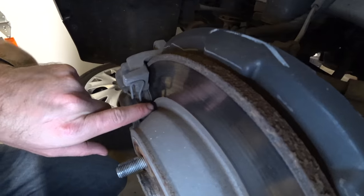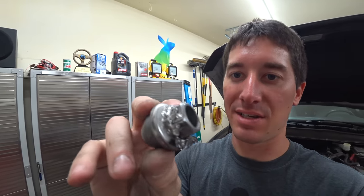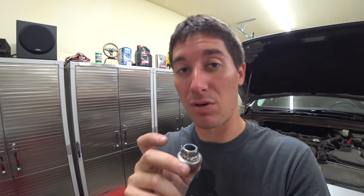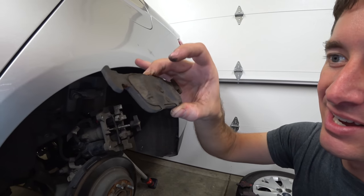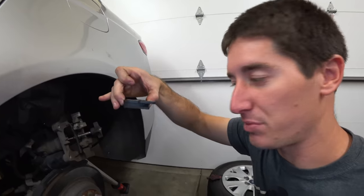As you can see, again on the passenger side, there is basically zero pad left. We'll go ahead and get these changed out and it should just take a few seconds. I took one of those lug nuts off and the cap basically just disintegrated. Luckily it's a 19 underneath. Maybe they were all 19s and they mushroomed into 20s like the dealership said. Here's an old pad for comparison — it has about as much pad left as the anti-chatter plate on it. And here is the new pad — you can see what one should look like and it's considerably better.